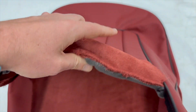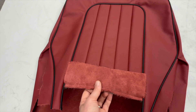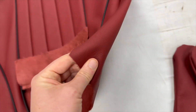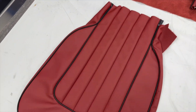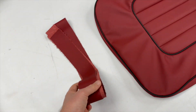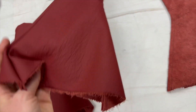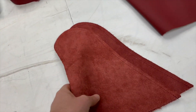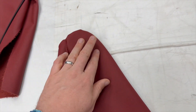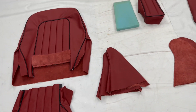The backrest covers again have genuine tuck and roll pleats, a retainer, finishers and the backrest back in leather as well. To show what would have been vinyl on a leather-faced OEM spec set: the horseshoe and pleated panel would be leather, but the retainer, side finishers and the backrest back would all be vinyl. For the cushion cover everything stays the same — surround is leather. Even on the leather-faced, the surround was leather, however the locating surrounds would have always been vinyl on OEM spec. The gloves would have had one side in leather and the other in vinyl on OEM spec. A neat trick on the gloves: trim back to that seam line layer — it allows you to push this up onto the framework giving lots of height for a closer gap. Do see my trimmed video for more advice on that.